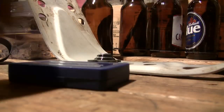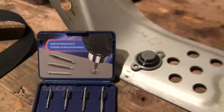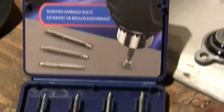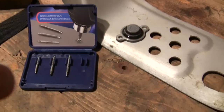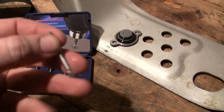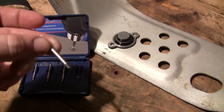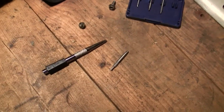I had to run to Canadian Tire because I don't even have a tool to get that out. I picked up these — they're called Mastercraft Maximum screw extractors. Apparently you first drill with one side just to get a groove, then you reverse the bit and it goes in and unscrews the broken bolt. Sounds easy — but it's usually never as easy as it sounds. We'll see how it goes.